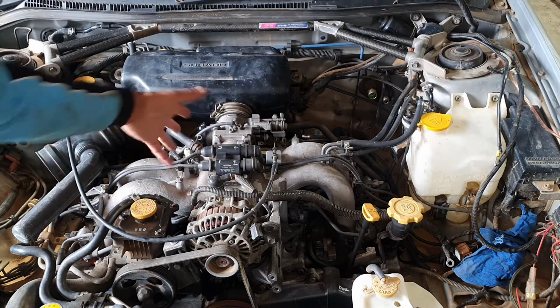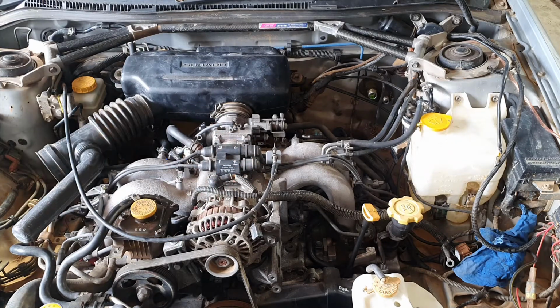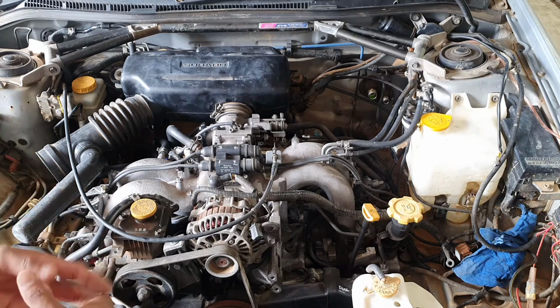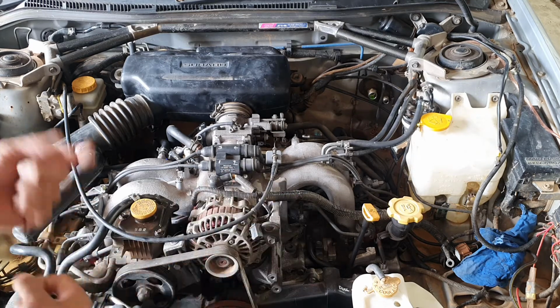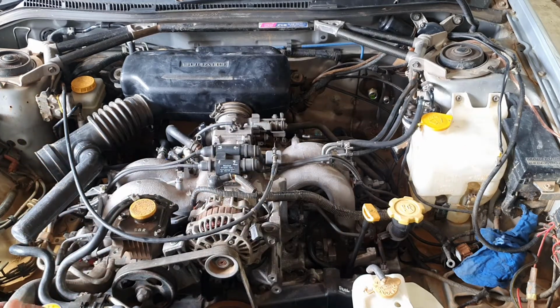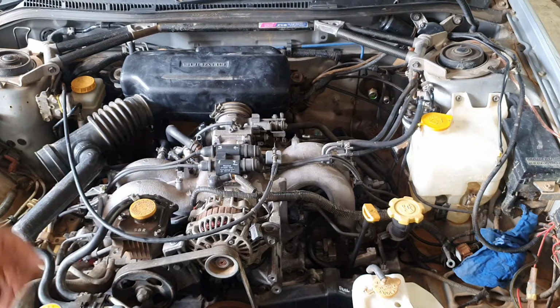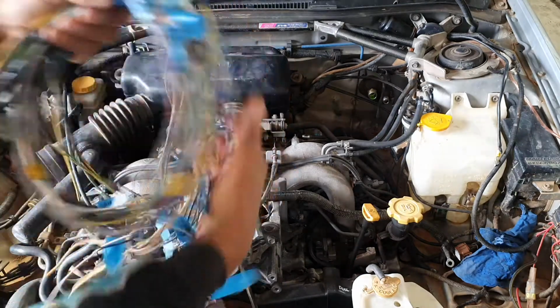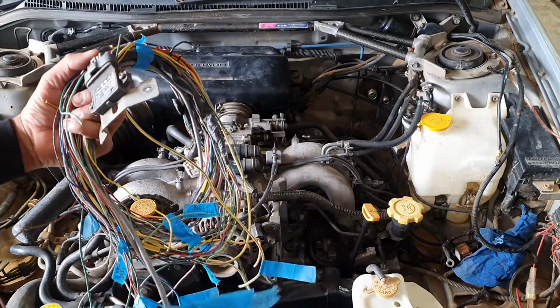So effectively it's kind of like having two coil packs rather than four, even though there's four leads on the top there. Now all of these are driven by wires, and all those wires I've already gone through and what we call pinned them out. So I've actually tested each individual wire to each individual sensor or injector and other bits and pieces on there, worked out where they are in the wiring loom, and turned it into this. Now it may look like a confusing bunch of wires in there, and to some degree it is.